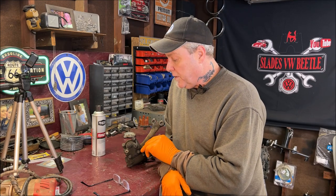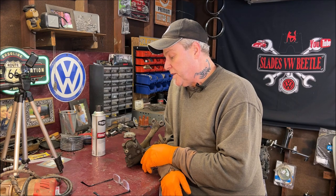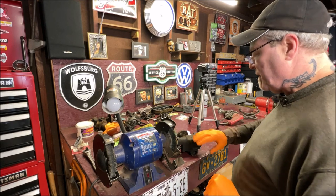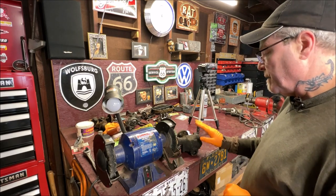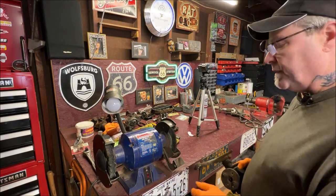I don't want to break these plastic plugs out yet because pieces of plastic could get inside and be harder to remove. So I'm going to clean this up first — I'll speed the film up on the cleanup because there's no point in watching me clean it. First I'll put it against the big wire wheel bench mount to get the heavy stuff off, then use a drill with a wire wheel for the tight spots. We do want it cleaned up and nice before we open it.